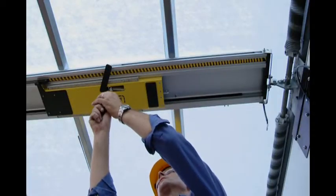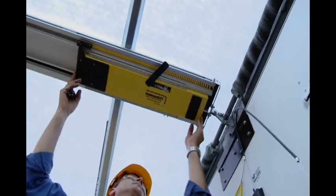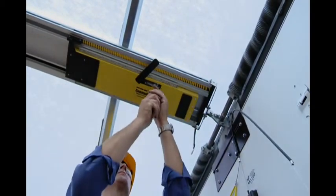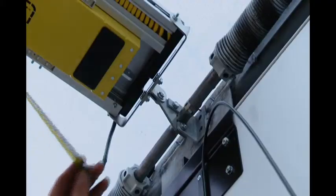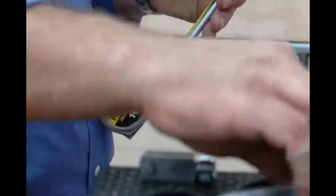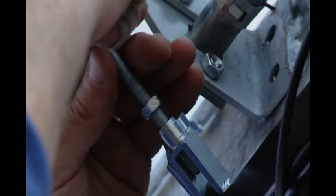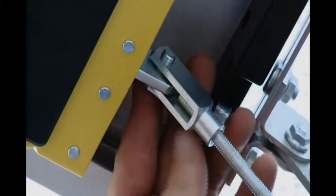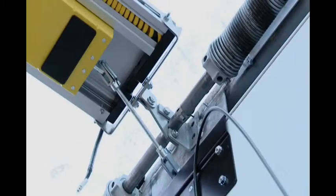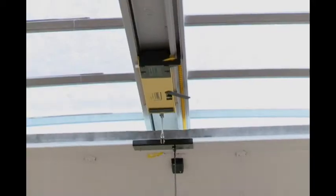Slide the Command Lift motor unit towards the door as far as it will go, then slide it back approximately three-quarters of an inch. Make sure the roll-up door is in the fully closed position. Measure the distance between the hole in the tab on the motor unit and the hole in the tab on the door plate, then cut the threaded connector rod one inch shorter than this measurement. Screw the end fittings on the threaded rod and clip the turnbuckle assembly to the Command Lift motor unit and door plate. The turnbuckle assembly should rest at approximately 45 degrees. Open the roll-up door by hand and confirm that everything operates smoothly.